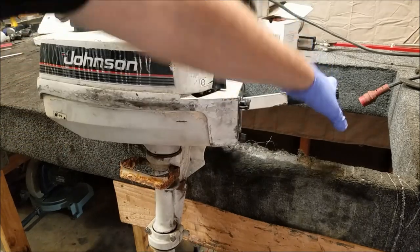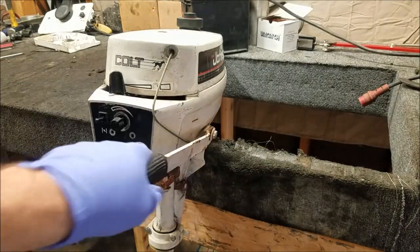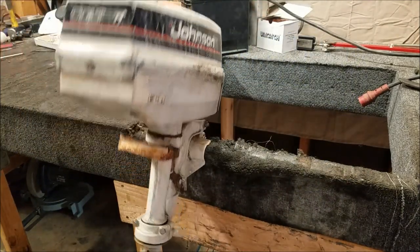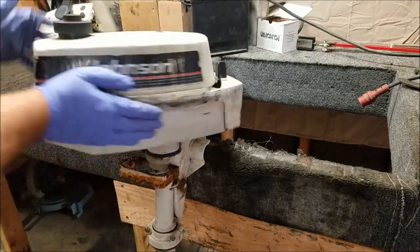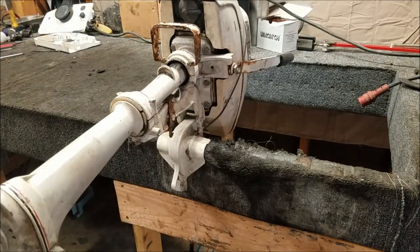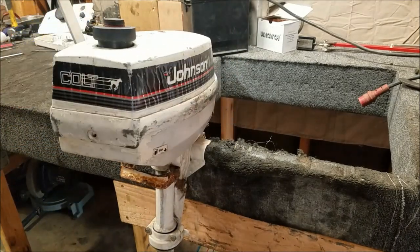With these little guys not having reverse — just on and go — you can tilt the engine all the way around. So that's kind of handy because I can work on it with it just sitting there. I can tilt it up, rotate it, and tilt it back up. So it's pretty easy to get to everything on these things — that's one of the things I like about them. And also it has as much power backwards as it does forward, because you're just turning the entire thing around, not running the prop backwards.